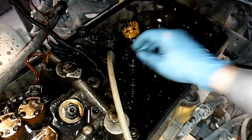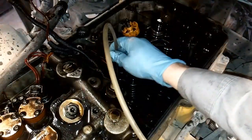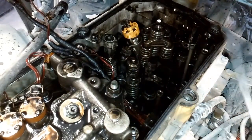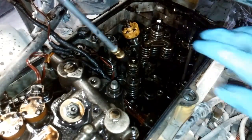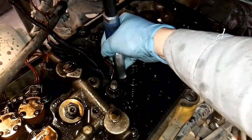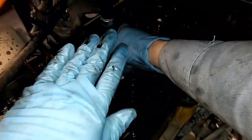So we're just going to make sure that cylinder is clean and get out as much as possible. Now I've already removed the rocker arms. If you're on an engine where the rocker arms do not need to be removed for the injector, you should pull the push rods off — you don't want anything to open the valves while you're doing this compression test for the cylinder you're going to be checking.